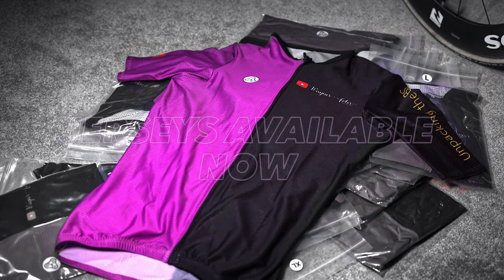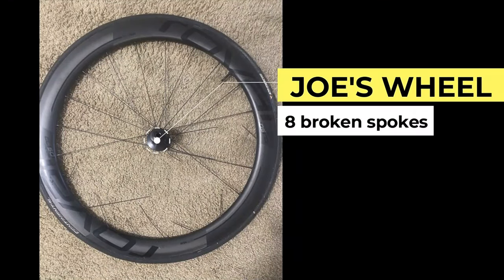The loading forces on a disc brake wheel and a rim brake wheel are quite different. On a rim brake wheel the spokes are in pure tension at 90 degrees to the rim and hub. On a disc brake wheel you have to angle the spokes with cross-spoking so they can transfer the rotational force from the hub to the outer rim. Looking at this wheel, I believe it had a 21-spoke system — 14 spokes on one side, seven on the other — where those seven spokes carry twice the tension of the 14, with a different angle due to dish.